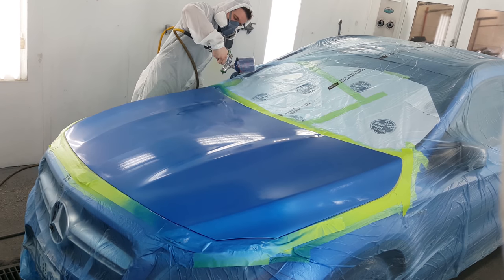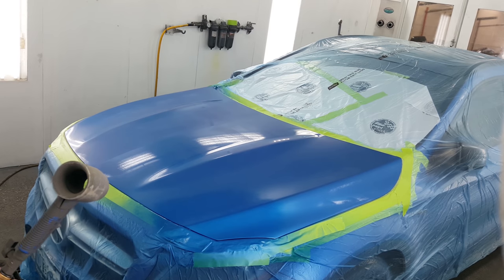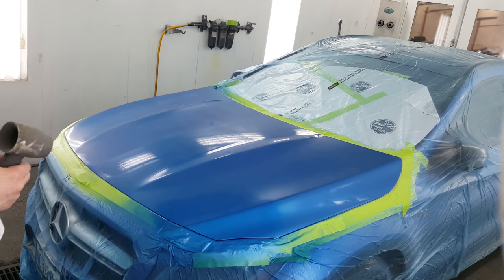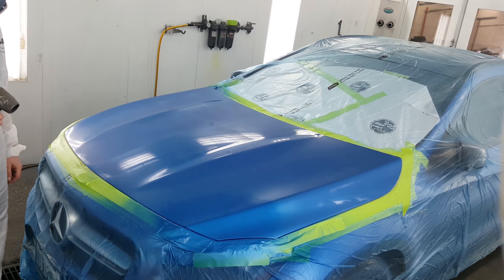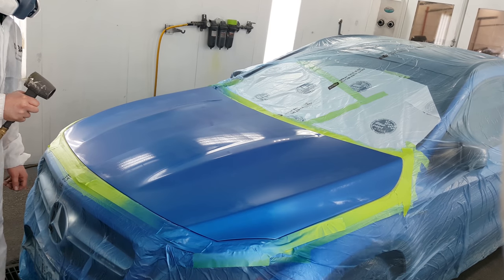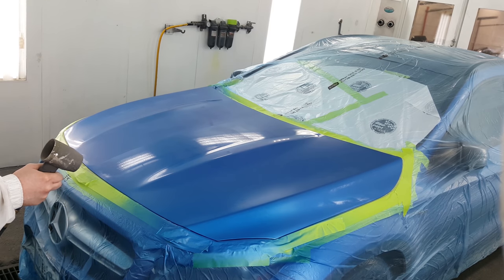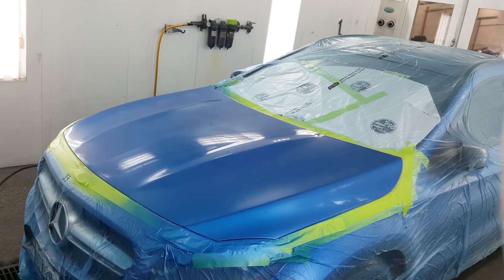What I'm working to do with this blend is keep it small and watch my arc. I'm gonna try to make a better habit of lessening the arc on the wrist and fading out the blend more using the trigger. I face a fair amount of criticism on the blending technique — it's YouTube, it is what it is. But there's some fair criticism on some of the earlier videos and everybody's always learning. We're gonna try and improve our blend technique every day until it's perfect.